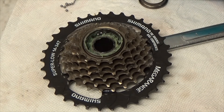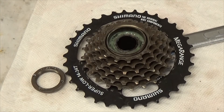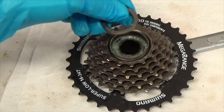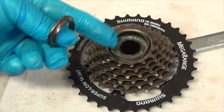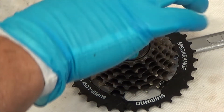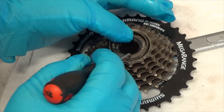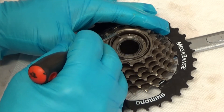All the ball bearings are in place. Now I'm ready for the left-hand threaded cap to go on. I want to make sure all the bearings are flat and down against the race as I put it on. To take something apart you turn it counterclockwise, so since this is left-hand thread, we're going to put it together by turning it counterclockwise. I have it set on top and will start turning — it should go on nice and easy.